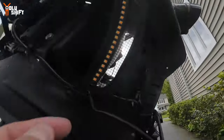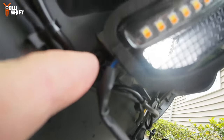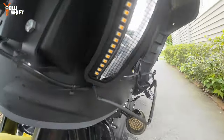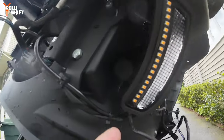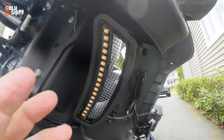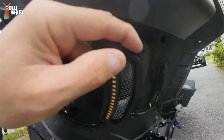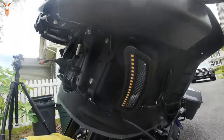I figured out it's really simple. With the fairing off, you can see there's a small little retaining screw over here that holds — honestly I'm not sure what it's doing, it's not holding anything. You just take it out, take the proper vent light, put the screw through that little bracket, and put it in — don't put it too tight. It needs the fairing placed over it to stay in position, so I used a little tape on top where it's unseen just to hold it in place until I put the fairing on.